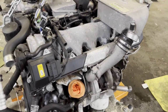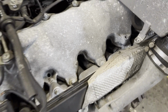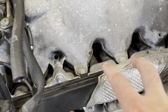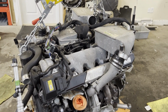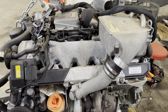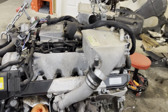I'm sure you all have heard about these V12 coil packs. These are actually twin plug engines. As you can see, there's two coils for each cylinder, actually offset. So this is 1, 2, 3, and so forth. 24 spark plugs and only two coil packs. There's one on either side. And they list for, I think it's $1,200 or $1,400 a piece. It's about 6 hours labor to do both sides in the car.